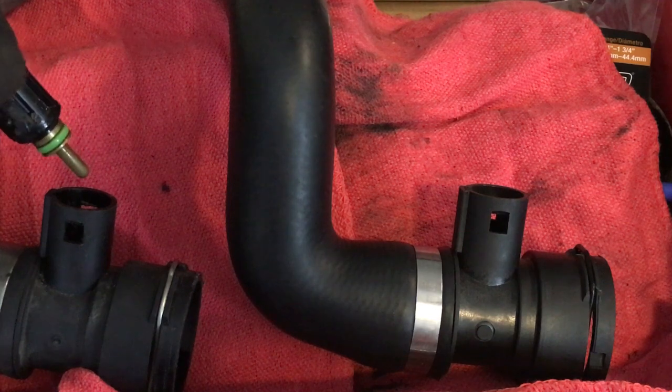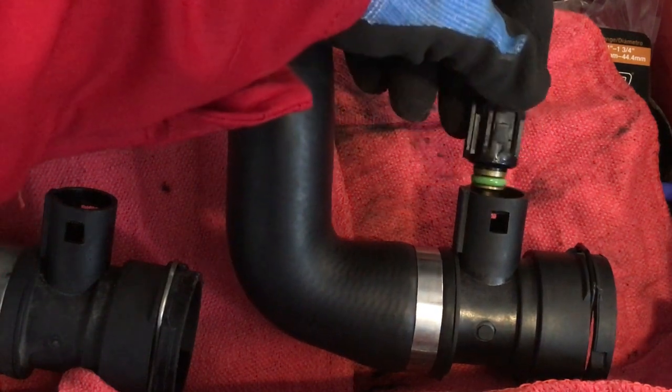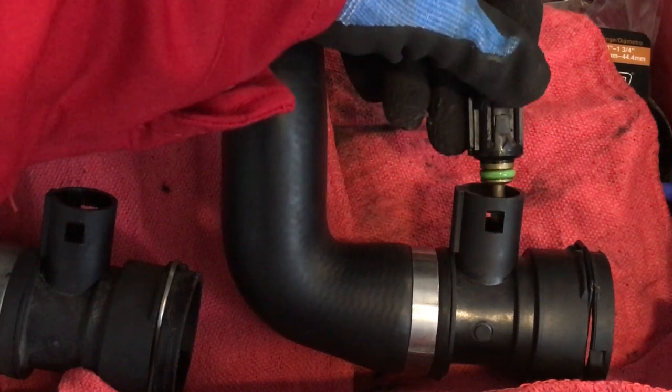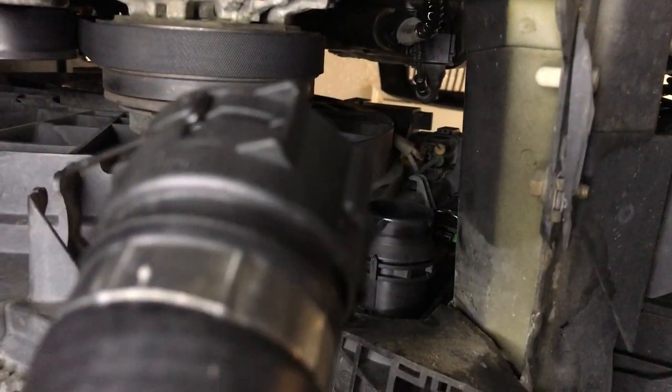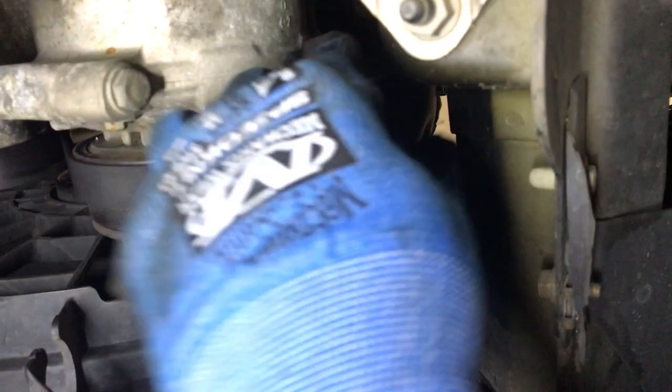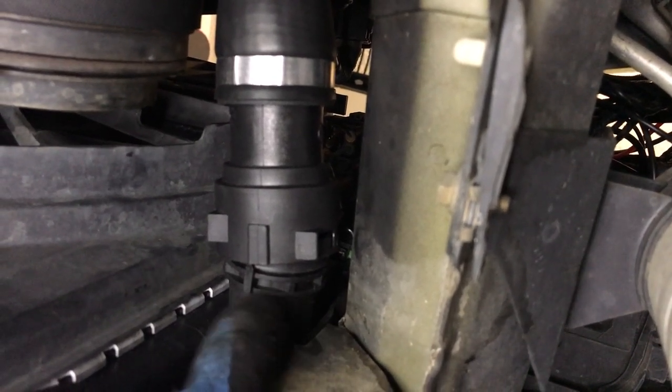Take the sensor from the old hose and put it into the new one. Dip it in coolant to get it wet. There's only one way it can go in — there's a guide that follows the groove. Push it in and it snaps right in. Now it's ready to go back in. Feed the hose going upward, line it up with the grooves, and apply pressure until it stops. Once the quick disconnect cover reaches the bottom line, you can lock the pin.